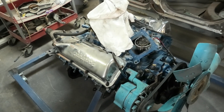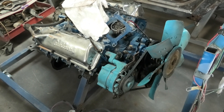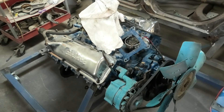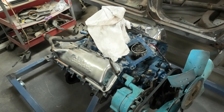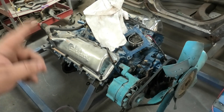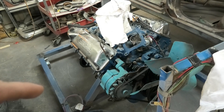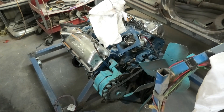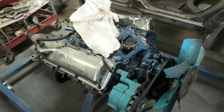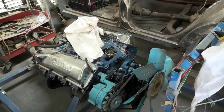So we're going to prime this motor thoroughly — prime prime prime — and I have new running-in oil, new cam break-in oil, all the stuff. So we're going to try and save it. This motor is kind of cool. When the sump was off I had a look and it's got new connecting rod bolts, the rods have all been tweaked so they all weigh the same — I was like oh somebody spent some money in here. It's got a 4MA crank which is the American 351 crank, but it's got 302 heads or at least closed chamber heads. The cam that was put in is quite meaty so if it doesn't chew the cam out on running in, fingers crossed it should be quite a good engine. The only downside is when he put the cam in he didn't put the fuel pump eccentric in there.